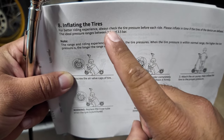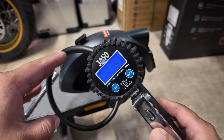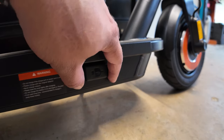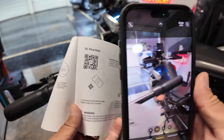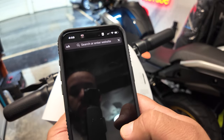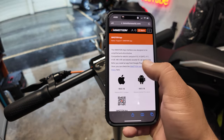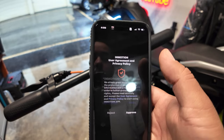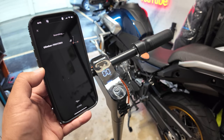This one doesn't come with any type of secondary settings like P-settings. We do have a little hand bell. To inflate the tires, it is 2.5 to 3.5 bars, which is about 45 PSI — I did about 48 on the rear. This is where you charge it, and this is how you download the application. There's a QR code — just scan it and wait until it downloads. Of course, you have to sign up to it.